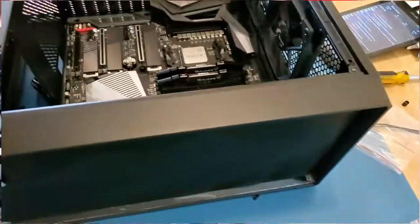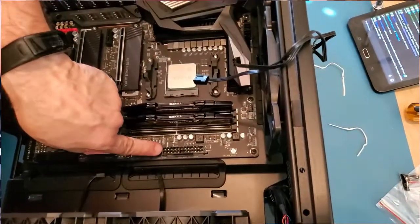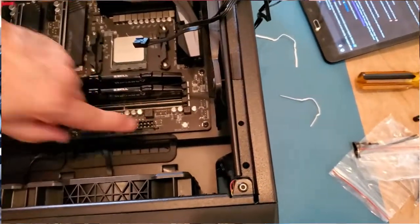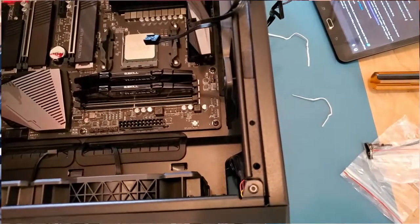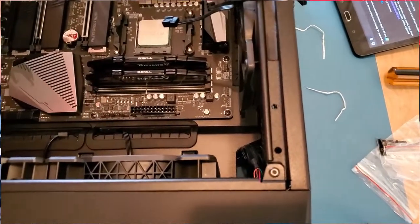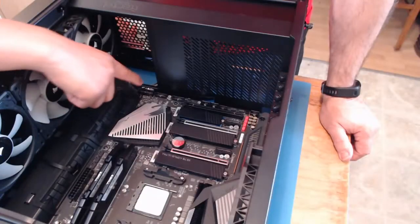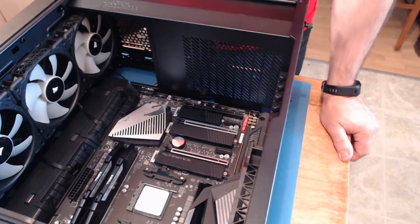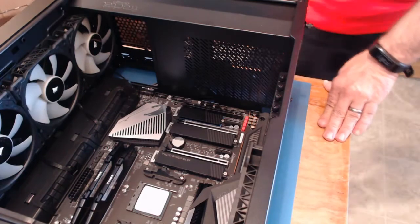Okay, then we're out. The motherboard is tied in. Now it's the 24 pin. You need a power supply. But before that, you want to do some cable management, which connects the power connectors and LEDs for the power light. This thing is very important. You want to take a moment to read the manual. Okay, out.